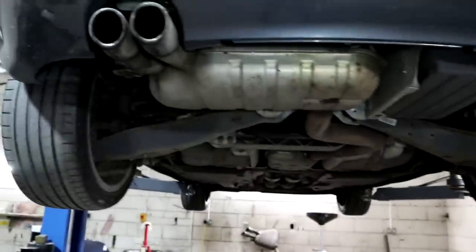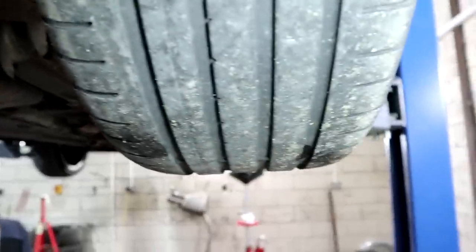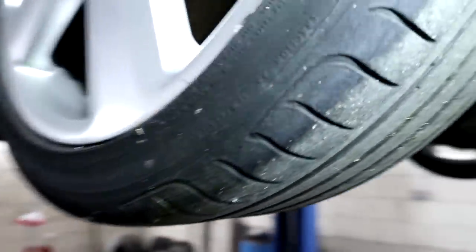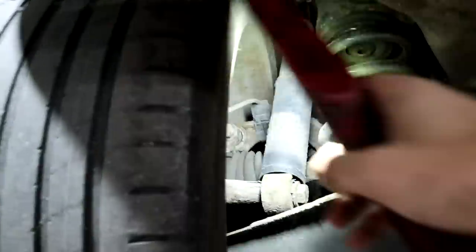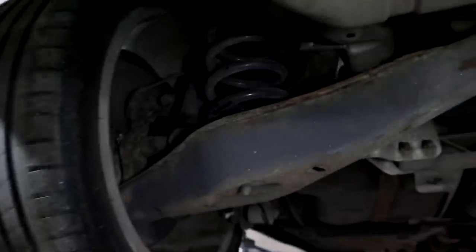Right, so it's got up in the air now, and I've had a look over quickly just so I know what I'm talking about. The only things on the rear, I don't think I'll get an advisory for that tyre. I'm pretty sure I'm going to get an advisory for this tyre because it's on about 3 mil and it's quite perished on the sidewalls. I've just had a look at the dot code and it's a 6-year-old tyre, so it's not horrendous, but there you can see my dust cover, look. That's just where it's fallen down. But everything else on the rear is all good.